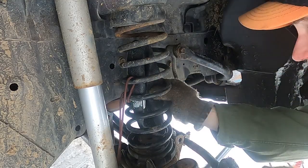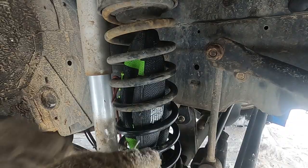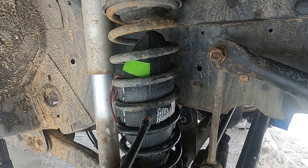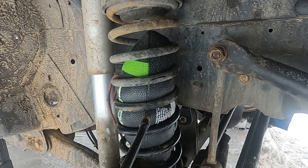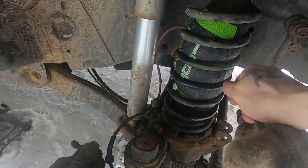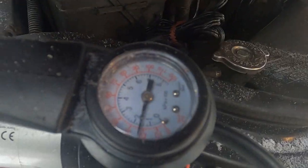We're almost done — really is that easy. Find that hole again and maneuver it so it's sitting in between two of your coils. Plug this guy in and start the compressor. You can see on this little pump there we're just shy of 40 PSI. Come down here, pull this out. There we go — close enough to 20. Good enough for government work anyway.